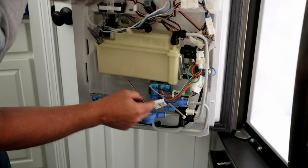My particular problem was with the tank. I believe it was probably that float valve in there that was not registering — it just thought the tank was full all the time. And therefore the pressure built up and the relief valve was open, just blowing water everywhere. So the tank fixed the problem. We're going to have to button the refrigerator back up now — put the plastic cover back on and then put the container holder on as well.